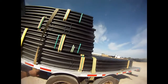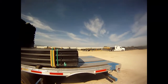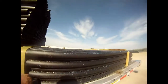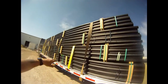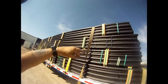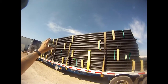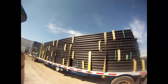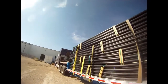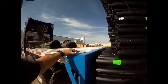That's my problem — you get a lot of plastic pipe issues sometimes when you have a big bow. Here's an extended flatbed — you can stretch it out and haul that long pipe, that's pretty cool. Staggered single here on the bottom layer, then I'd like to get one on the bottom, two on the next layer, two on the next. I had to tighten them down a little bit — that pipe is going to flex just a tad, it's also going to settle. As I go down the road things will settle in and down, so there shouldn't be any problem. Everything looks pretty good, I think we're ready to rock and roll.